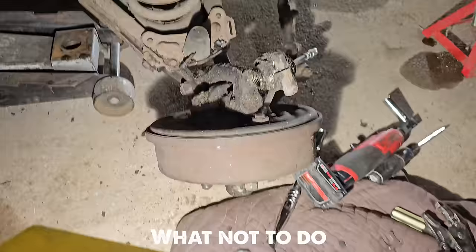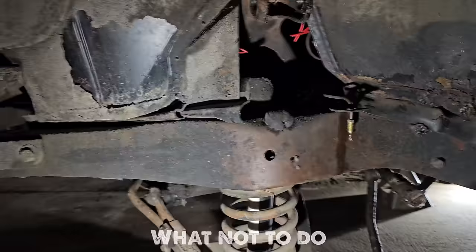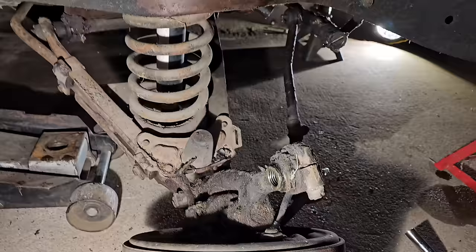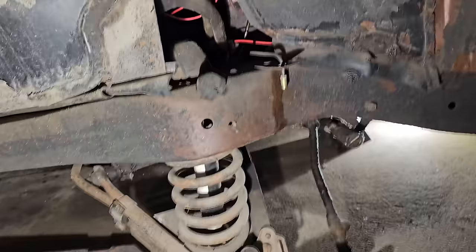I got this knuckle down. Looks like we just unthread the top knuckle, and it basically unthreads out of that upper control arm, or upper A arm, which is fantastic. Only bad part about this whole process is I had to end up pulling that brake line. Should be fine. It's got a whole new rebuild kit in it, so it should bleed just fine and come back to life just as fine.